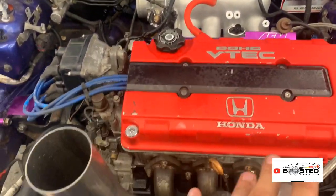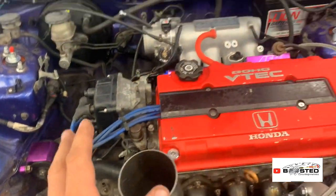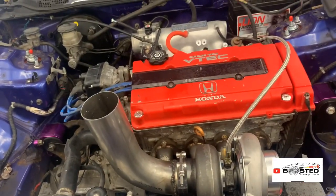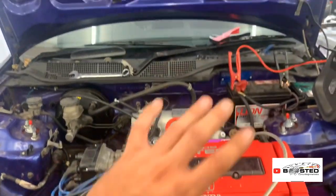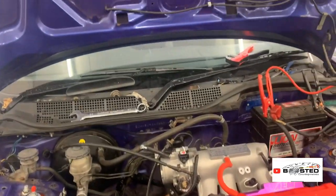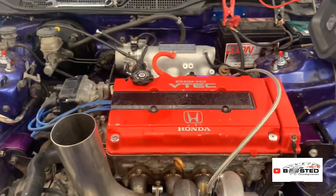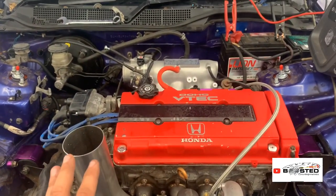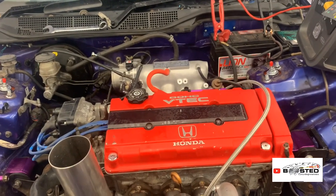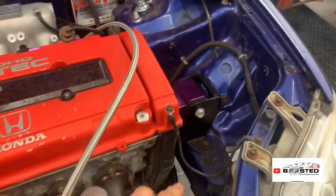Then what else did I do? Obviously I took the dizzy off and uploaded the base map, and I thought, let me crank it. And it came up with an engine code, ELD, electrical load detector. Cannot remember what that is at the minute. My memory's shocking with all this sort of stuff, as you know. And now I'm cranking it, it didn't want to crank, and I thought, what have I gone wrong? Typical, what I've done on the K20 as well.